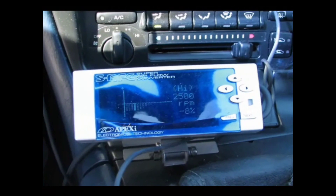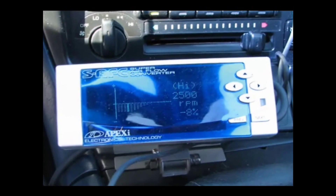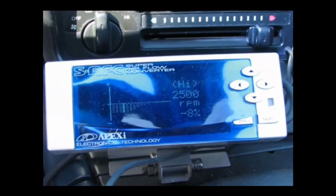This is the AFC's high throttle map, and at this point in our tuning we are taking out fuel only in the lower RPM ranges. For this run we've got the fuel pressure regulator set to 38 PSI as the base fuel pressure, the AFC taking out some fuel in the lower RPM ranges, and boost at 22.6 PSI. We've got our G-Tech meter set up to data log horsepower, torque, and RPM, and the laptop to data log those air fuel ratios from the LC1 kit. Let's try it out.